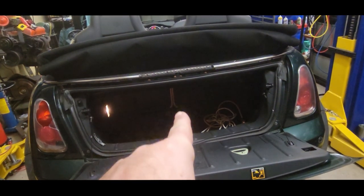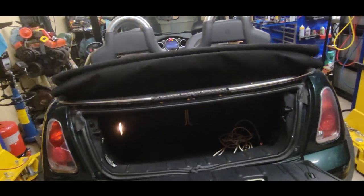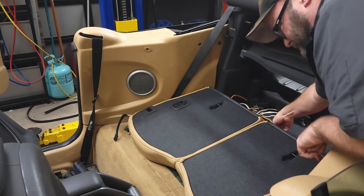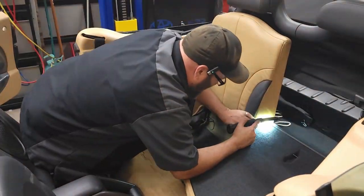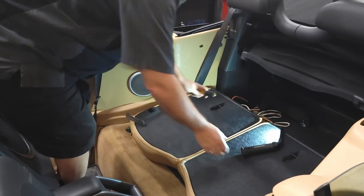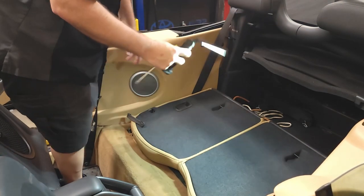To get these back seats out, in between with a seat split down at the bottom, there's a 10 millimeter bolt down there that you've got to take out — that allows you to move this. There's a latching system in there; that bolt comes out and allows the latching system to actually work. So first things first, I'm going to get these folded forward, get the bottom of the seat out, and then get these folded forward so I can take them out.